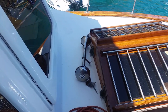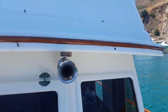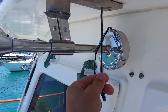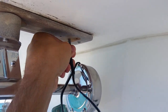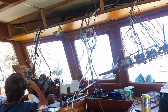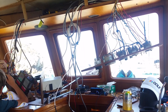The horn has been working and not working intermittently. I thought it was a wiring issue, but I think the actual horn is bad, so I installed a new one and then opened up the dash to discover the wire lead from the horn button back to the horn has been respliced in five places — three of which were joined together with wire nuts and the other two were properly crimped. So I removed all the wire nuts and reduced the number of connection points.